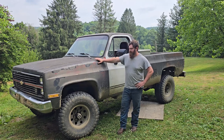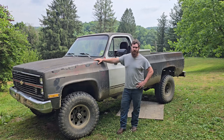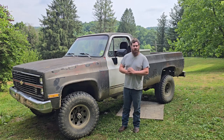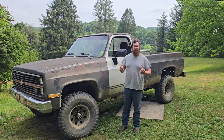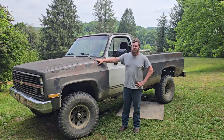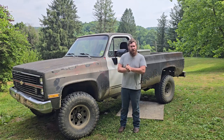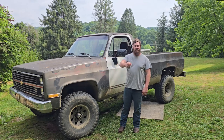We're going to have to wrap it up there. I have a couple of smaller projects I need to do — I finally have the parts for the rear end, so I'm going to go ahead and do that because it needs it bad. I do have a couple of issues: yesterday this thing acted like it was running on four cylinders and running richer than hell, but I unplugged my O2 sensors and plugged them back in and it ran smoothly. I might have a problem with the old O2s not reading right and forcing it to run super rich, or a bad ground somewhere. I appreciate you guys — I'll see you next time, and you have a good one.